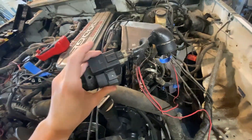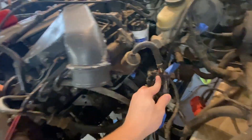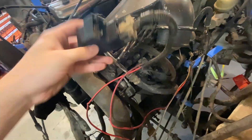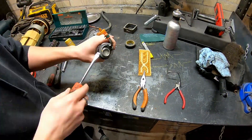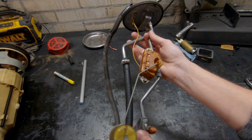One of the circuits I need to figure out is this relay that'll turn on the fuel cutout. This is the fuel cutoff for the Cummins — this is what stops fuel from being pumped when the key's off and allows it to be pumped with the key on. A bunch of videos ago I had to make the fuel tank work for the diesel Cummins, and one of the things I did was remove the fuel pump that was in it. When I removed the fuel pump there were a couple of wires I ended up cutting that I said I might be able to find a use for later. Well, this is that use.